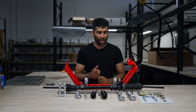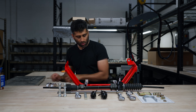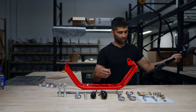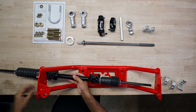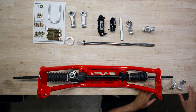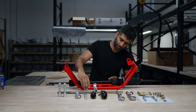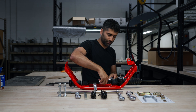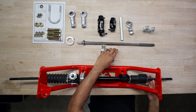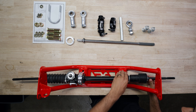The first thing we're going to do is pre-assemble the steering rack to our crossmember. We'll take the rack clamps off and install the steering rack through one side. There are two styles of rack clamps — one with the bigger D and one with the smaller D. We'll raise the steering rack up a little bit; these clamps provide a nice tight fit so in conjunction with the poly bushings it'll hopefully sharpen up a lot of that steering.